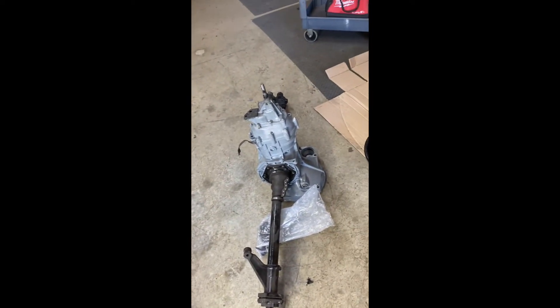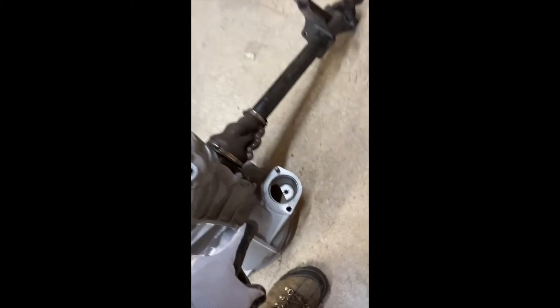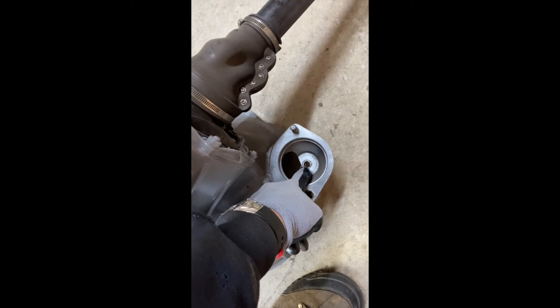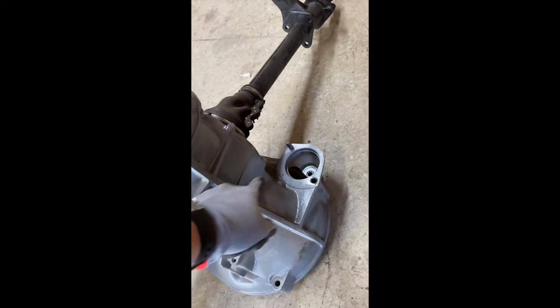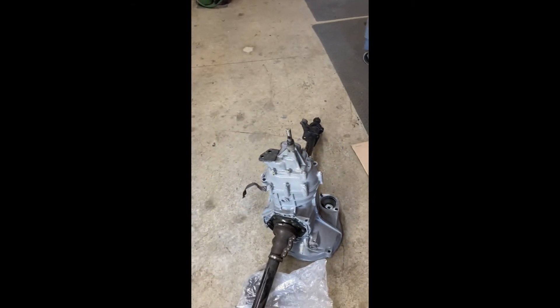Also you have to consider the 12-volt changeover if you're going 12-volt. You can see this one is really big — that's six-volt. This smaller one is 12-volt. If you're changing to 12-volt, you have to grind the inside of your case because the 12-volt flywheel is bigger.